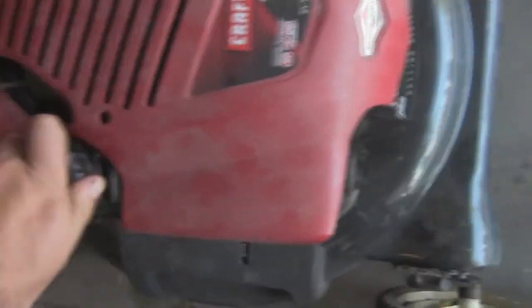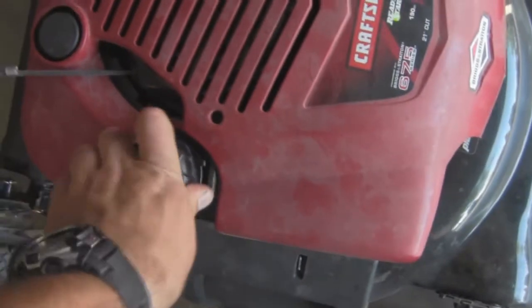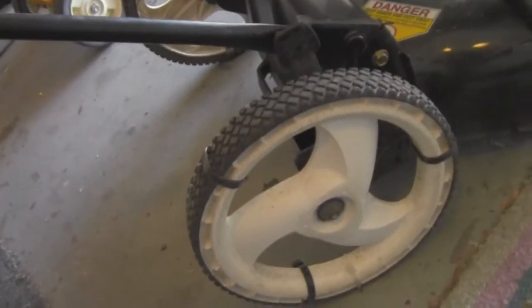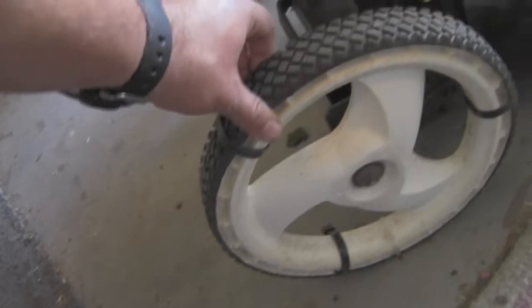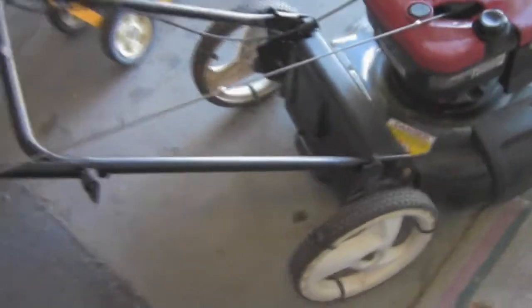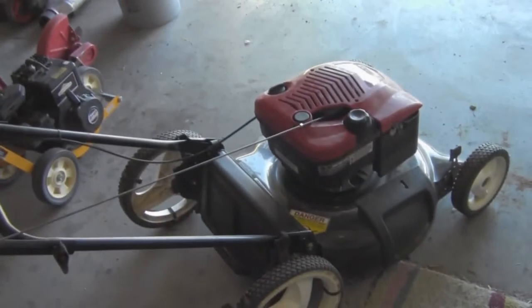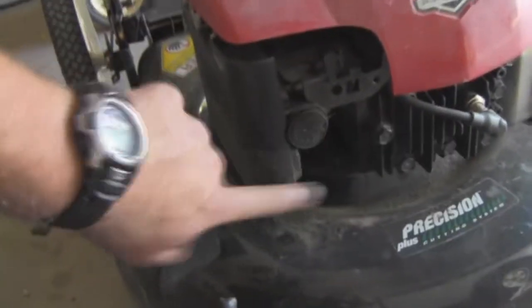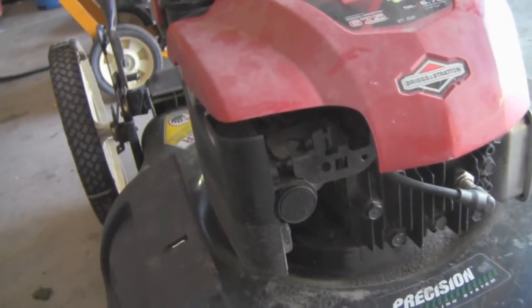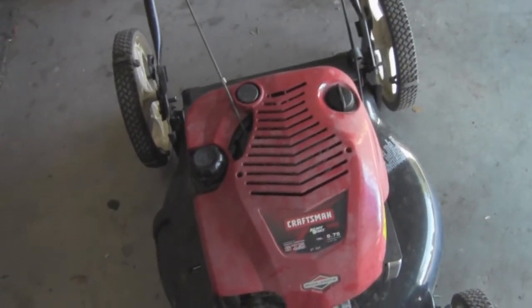It does run okay — in fact, I'll start it up for you guys. Interesting gas cap. There's a little bit of gas in there. The oil level is good. These wheels all seem to develop this problem where the treads kind of come off on the sides, so we zip tied them back on. I do have another pair of wheels I could put on there, so that's not a big deal. Unfortunately, it is the ready-start, so it does not have a primer on it. I really don't like this setup — they start to have issues and become very temperamental. This one's on its way to becoming like that.